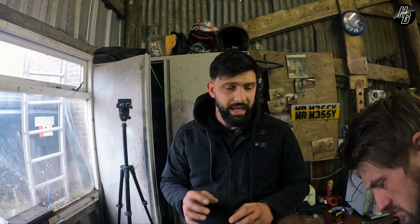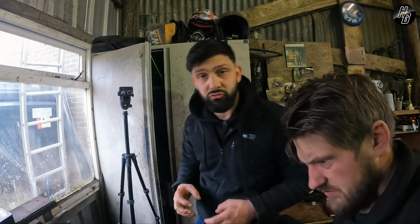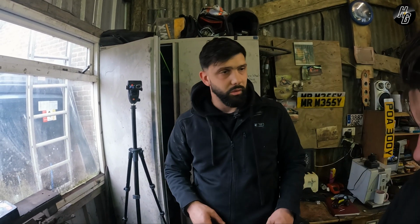Yep. What we're going to do now is go back outside. We're going to put a block in the front suspension so it doesn't collapse, drop the front back down, then we're going to lift the back up. The back definitely has hydraulic pressure in it, so we're going to have to release them very lightly, and we're going to remove one of the rams first and just get our pal from Lay and Play on the phone and ask him what we're looking for on that ram to make sure those rear rams are okay. So one apart, one to go.